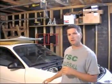Okay, this video is all about getting started. One of the first things you do when you're doing an electric car is you measure the height of the wheel wells, because you're going to be adding a lot of weight in lead acid batteries if you choose to do lead acid. And that will tend to bring the car down a little bit. So you want to know exactly where the car should sit so that if you need to redo the springs or the shocks and struts later, you know exactly where the car should be.